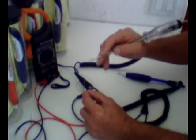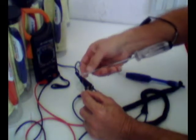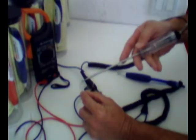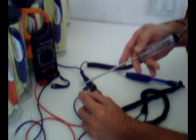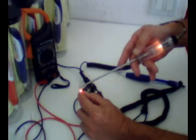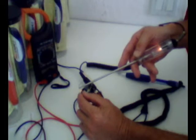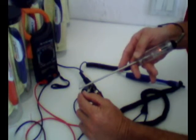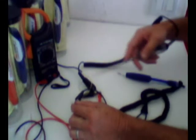I am going to show you — if you look very closely at the LED — we are going to hold this on the LED. When we touch this LED, watch the illumination of the LED. This could be your sensor, your gauges, or many of the other things in your vehicle. Notice the illumination dropping. Right now it has dropped 50%, 60%, 70%, 80%, 90%. What it is doing is burning out the electronic component. This happens a lot and inadvertently, we take out a lot of electronic equipment in cars because of this test light.